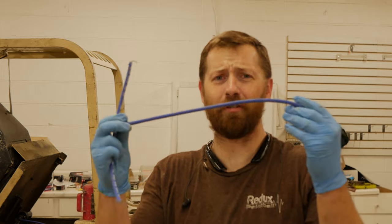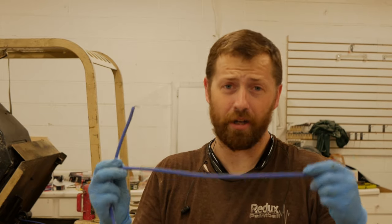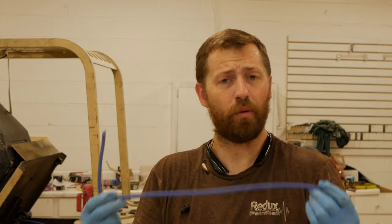So what it boils down to is any extra length of wire that you have is one additional resistance, which even, you know, on a foot of spark plug wires, is not that much. Okay, let's be honest. So it's not really creating a super more powerful spark if we shorten the wire. The real benefit comes in chafing and wear over time.